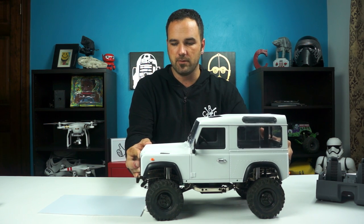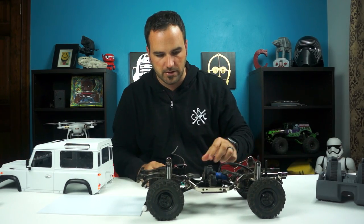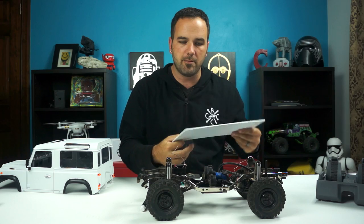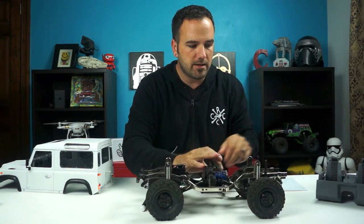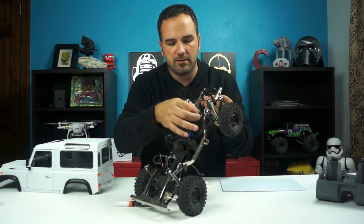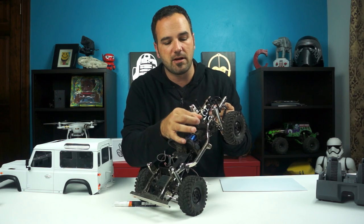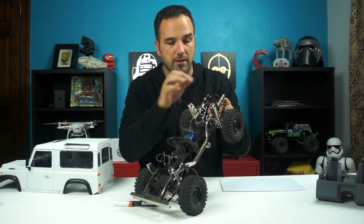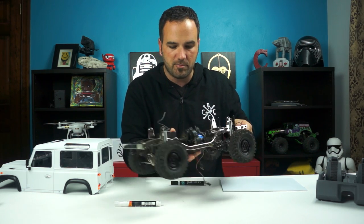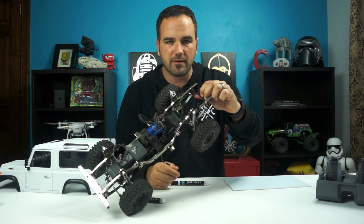I want this body sitting pretty much over these tires, so I have to cut off a little bit of the back frame and put a brace in here to keep it from moving too much. I bought this styrene — it's a pretty thick piece but it's easier to cut than metal. My plan is to put it back here where the battery mount was before. You can see these straps in here where it held the battery, which is just a terrible solution from the get-go. I'm going to cut this piece of styrene to fit right onto these two plastic mounts here for the battery.